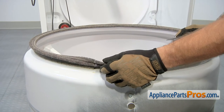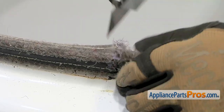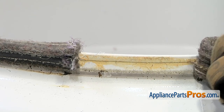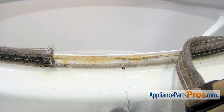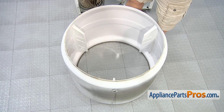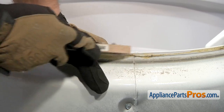With the drum out of the dryer, we're going to take the old seal off. You want to get behind it with a razor blade and if it's not torn already, you can just cut it. Once you have it cut, you can very carefully peel it off around the tub. Once you have it all the way off, we can go around and clean off the residue as best as possible before we put the new one on. Now that you have the old drum felt seal off, you want to make sure you go around and clean off all this residue as best you can. We're going to go around with a wire brush and clean it up.